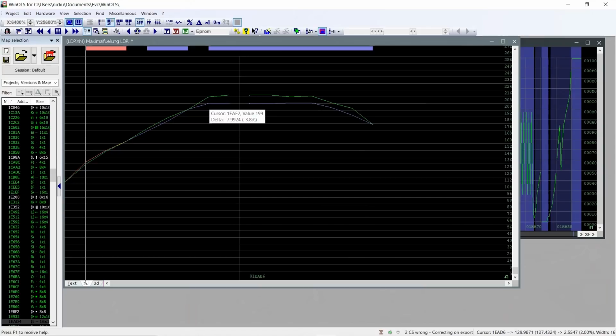So if we look straight away at boost, obviously boost in ME 7.5 is controlled by load. So you don't specify boost, you specify engine load, or cylinder fill, cylinder capacity fill. And there's a rough translation that I use, and that is that the max boost that I want is going to be about 1.4 bar on this map. I just looked and that's 20 psi, which is pretty tame, to be honest, for a K04. It can be pushed more, which I think we will, but that 20 psi, 1.4 bar, using the calculation, comes at about 200% load here, and then I've just made a nice straight line, so the boost should come in nice and linear, based on RPM.